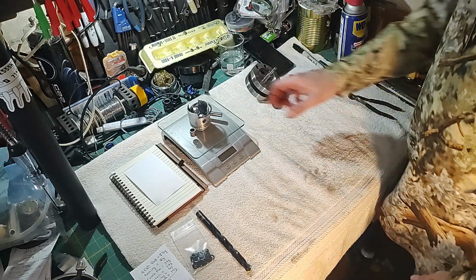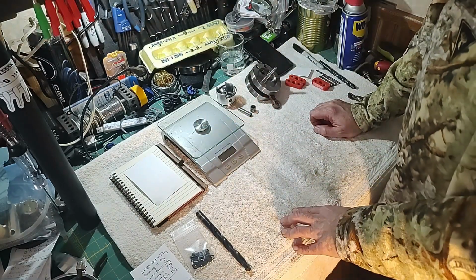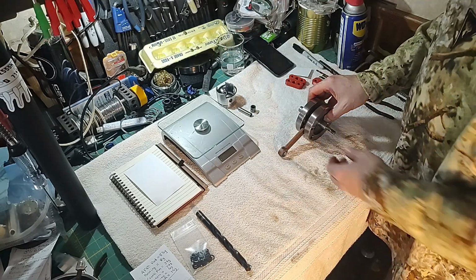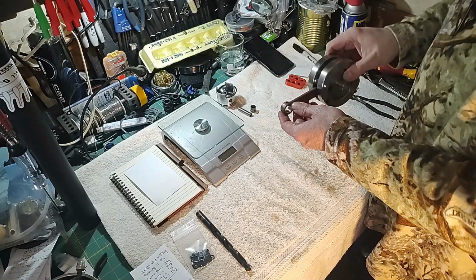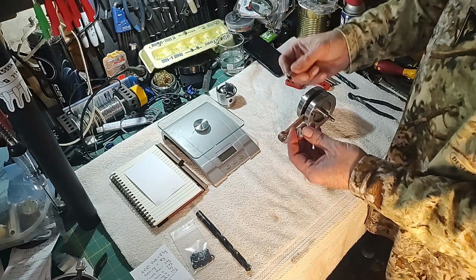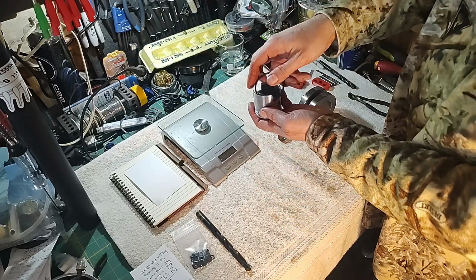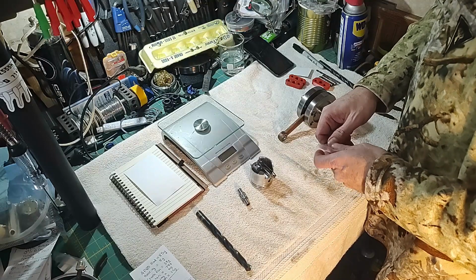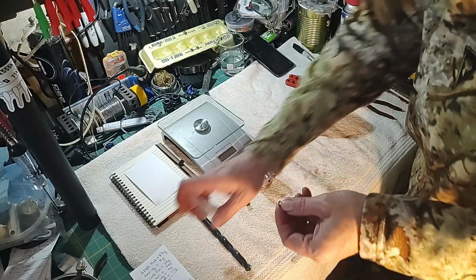So first off, let's figure out what's going on here essentially. I've watched some videos and stuff. There's a few different ways to getting this figured out. The more obvious is we at least need to get some information on this connecting rod here, and then the weights of our piston, connect pin, and our rings and everything all together to get the full amount of swung weight. Actually, grab a couple of these clips here. Add that to the weight.